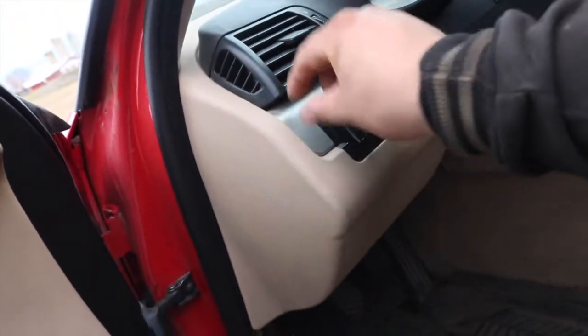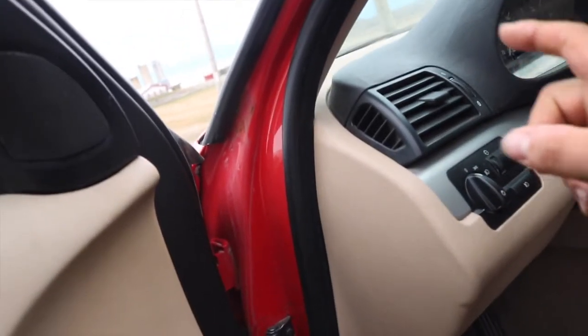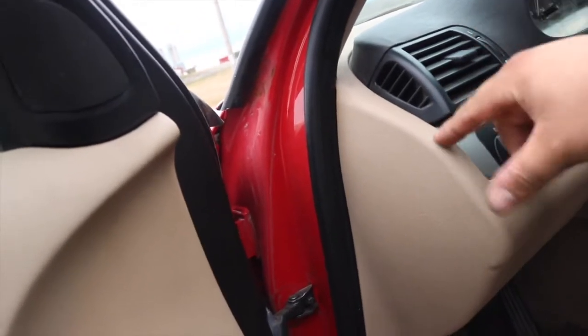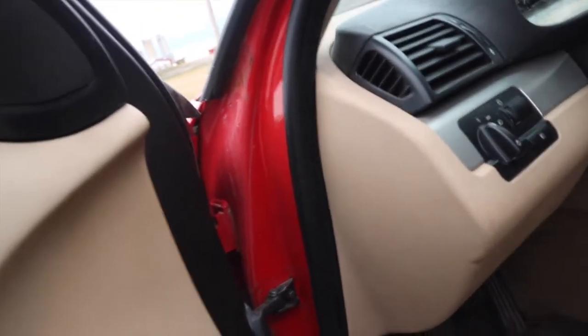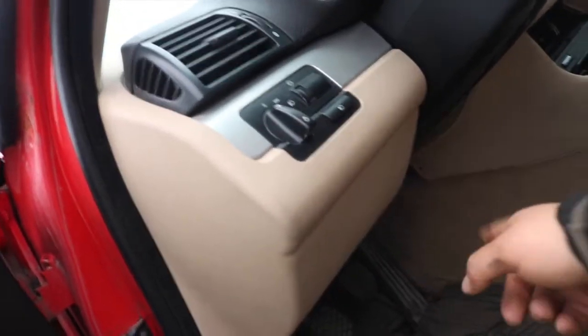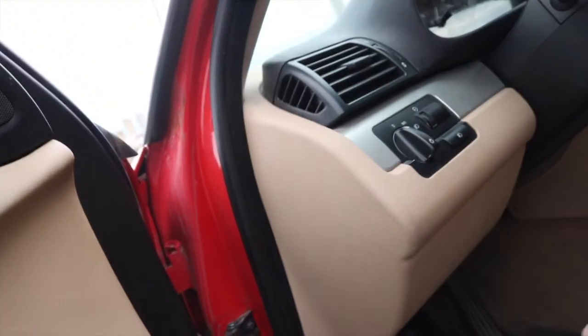Problem with that is at the brake sensor switch, I don't know if I'm able to get a video in there. Not really. Anyway, the brake sensor switch is like magnetic, and what I had to do was pull it out. So when you press on the brakes, the brake lights don't turn on. Since it's a magnetic plug, basically you just put it on any metal piece and you tie wrap it around, so it's not going to move. The reason why you can't just unplug that is because if you unplug it, the gas pedal doesn't work. So if you take it out, ground it to metal, then you'll be able to do your brake burnout.